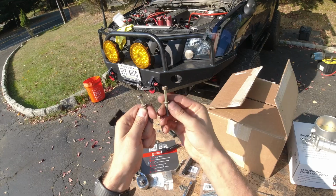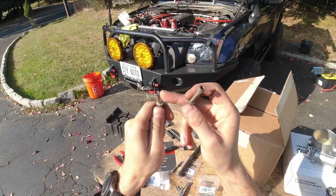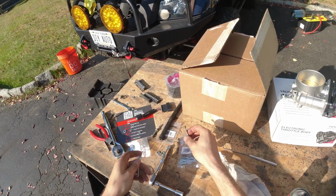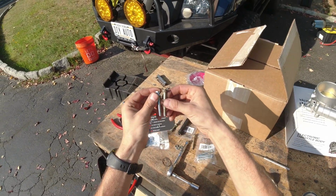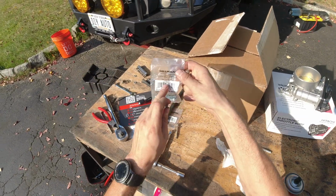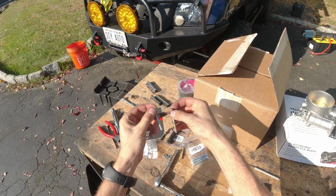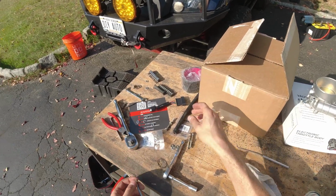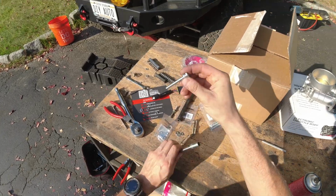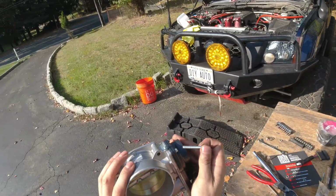Now of course, unfortunately, I'm not gonna be able to use these bolts, because they got, especially this one, completely destroyed, but luckily I was able to take it out. Wow. So what I did, I went to the store, I picked up M6, this is M6, 50mm bolts. So that's what I'm gonna use, and they're grade 8, so they should be alright. Of course I got the washers, and yeah, so I'm gonna use that now. Let's see, let's hope it works.